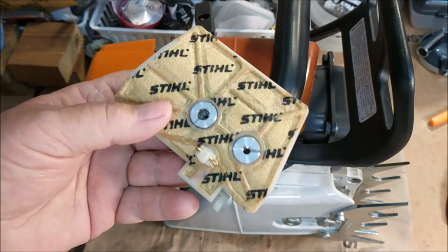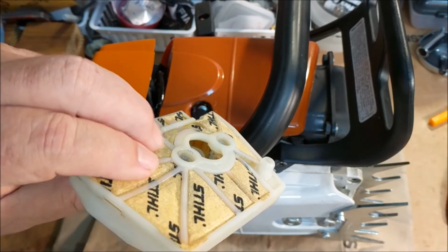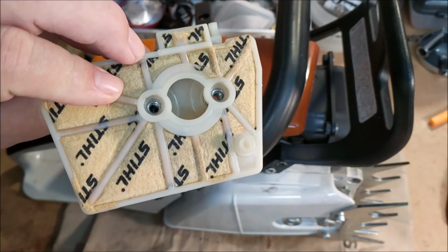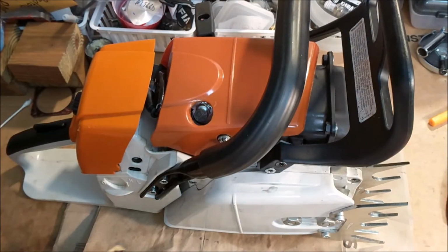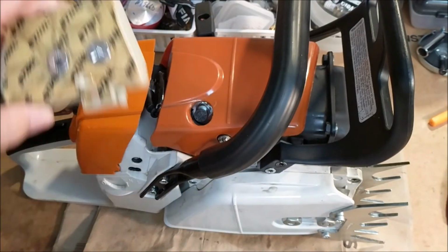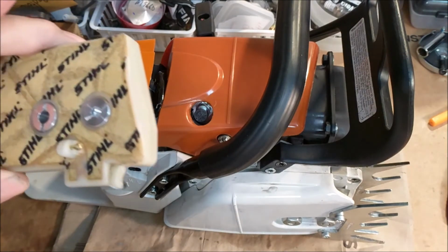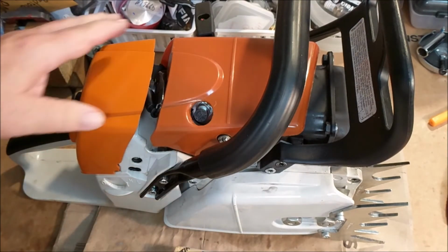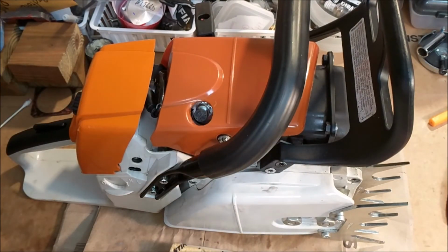So I had trouble getting this OEM on. The OEM had a stronger spring in it, which there's the choke, right? So to get it to run and operate properly, that needs to work. So I can get it on and so forth, but this is just a hint, okay? So you can circumvent this. You can use some carb cleaner and crank it up and warm it up, and then this isn't as important.